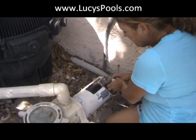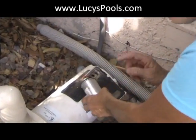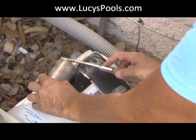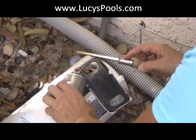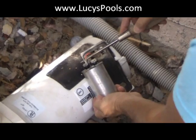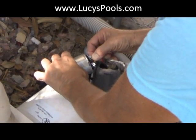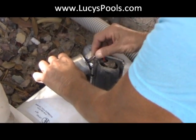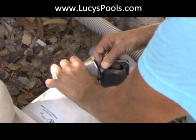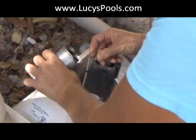What you're going to see is these two wires hooking onto these terminals. Before you touch anything, you want to disengage the charge if there is one. If there's anything left, put your screwdriver across both terminals. Then we're going to pull these wires off — you could use needle nose pliers.